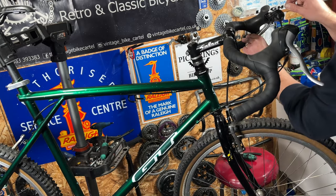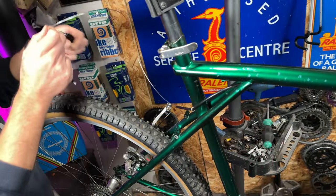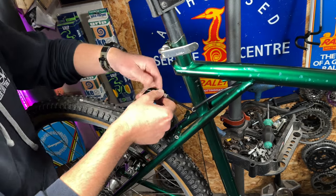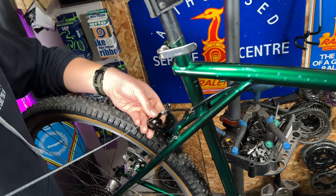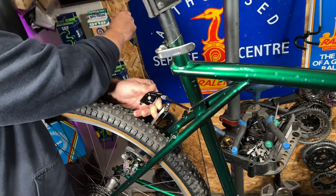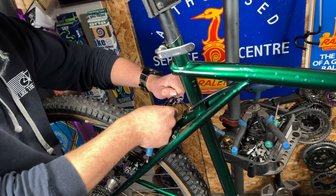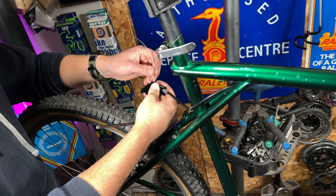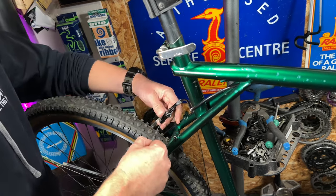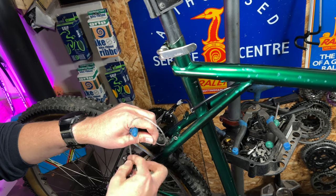The back brake is pretty much the same as the front — I will be honest, second time felt so much easier. Don't forget that angle: you want that cable coming into the big pulley at the back at the one o'clock to two o'clock position, otherwise you're not going to get the throw that you need. Use the barrel adjuster on the top to make minor adjustments either way.